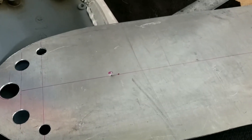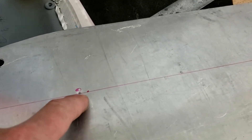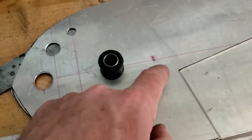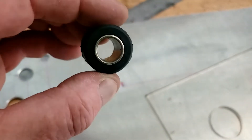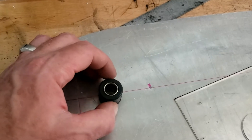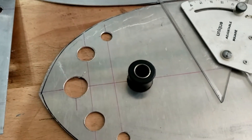While we've got the drill out, I've decided I'm going to finish these aluminum plates off and just see what it looks like. I've punched a hole here and on the bottom piece, and here's the corresponding hole on the middle piece, ready for this spacer — which is ginormous obviously because it's for suspension. That takes a 12mm bolt, but I'm only going to put an M6 in it — it doesn't matter, it's just going to join the two together. And then we've got another one down here which marries up with the top plate. I'm going to drill those out and hopefully get them in place for next time.